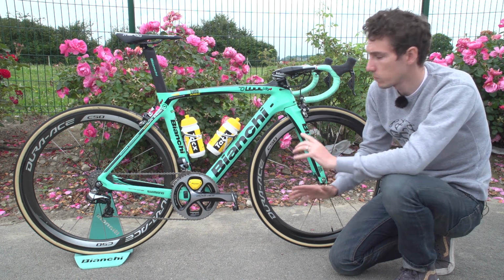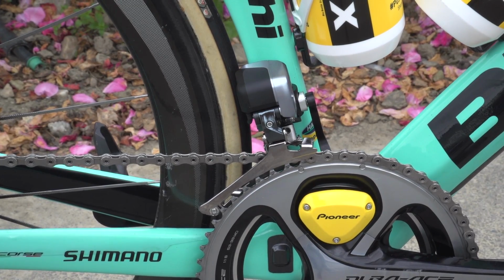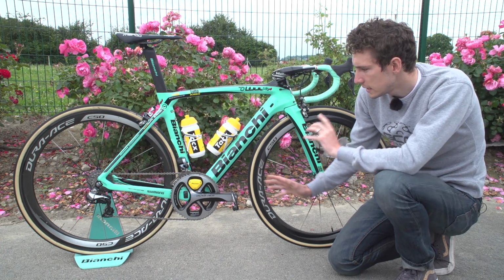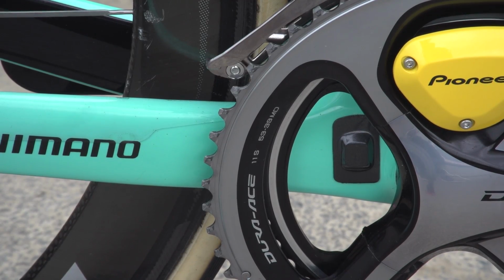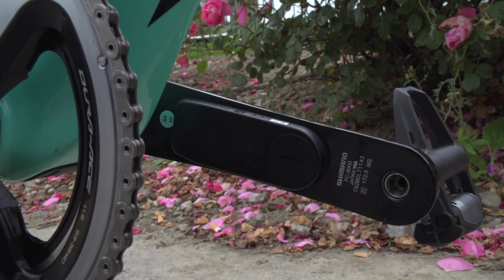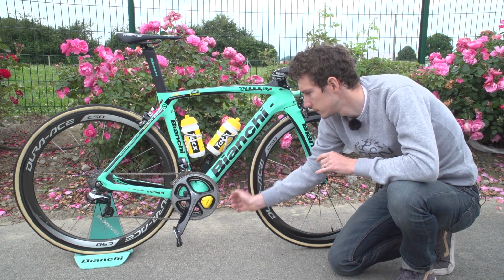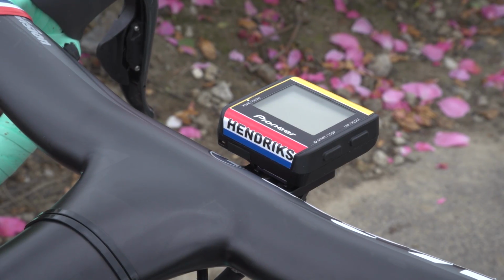What else have we got on it though? Well, full Shimano Dura-Ace Di2 groupset. Comes as no surprise, the Lotto NL Jumbo team are sponsored fully by Shimano. No surprise component choices either, 53/39 chainrings here and an 11-28 cassette. There is the addition of the Pioneer power meter, which you can see there, and then the other side of it is on the left-hand crank there as well. And then because of that, we also have the Pioneer head unit up here as well.